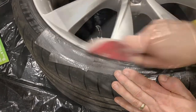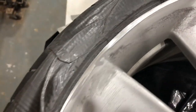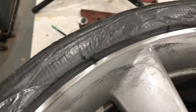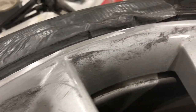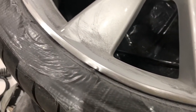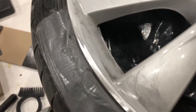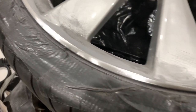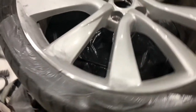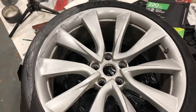You can see the almost-finished product here. There's a little bit more sanding involved, but it's pretty close to the factory edge or the factory look. No fillers — I decided I didn't want to use them since I'm just not confident they're going to stay. In this case I didn't think they were deep enough to need them. If it was just a pit I would do it, but in this case it's a big long gouge, so I thought no fillers required.